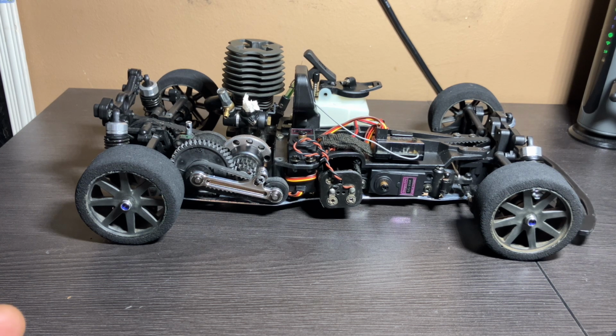Now you can do a 47 in here, but it's not going to work as a direct bolt-in. You're going to have to get a motor mount so you can shift your motor around. You might have to get different bell housings to play with the mesh, and maybe a whole host of other things that I don't know about yet. But as far as I do know, the 43 from the RS4 3 fits the RS4 2 just fine. No issues.